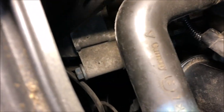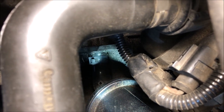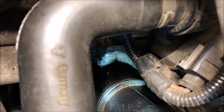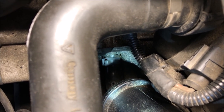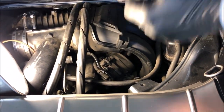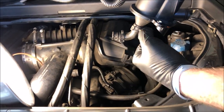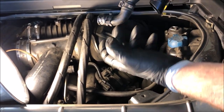In the very bottom here you're going to see a hose connected on the bottom — it's connected by a compression clamp. So we're going to need to tape that off so we can pop that. I have a new L-hose to go in there; I figured I might as well put a new one in while I'm at it. I finally got this out — I was having a difficult time, so I decided to take off the other two hoses first. The bottom feeder tube really is not as bad as I thought. I got a pair of pliers and had to crawl underneath to get my arm in a certain way, but it doesn't take much pressure to release that.